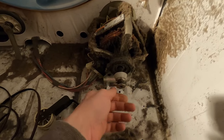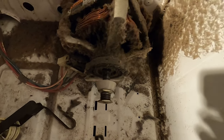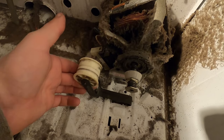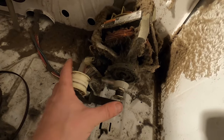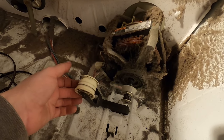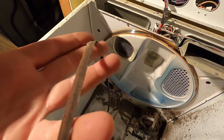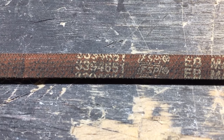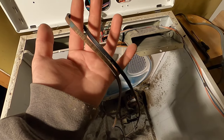This is the motor, so the belt rides right on this right here. After some investigation I found that this actually clips in here — this is the belt tensioner. It's got some spring to it, so the belt goes around this and then in here, and this holds tension on the belt so it doesn't fall off, and then it goes up and around the drum. Now I've got to take my belt and find a number on it. In my case this is 339465-1, so I'm going to order this belt on Amazon, and if you have this dryer I'll leave a link in the description.